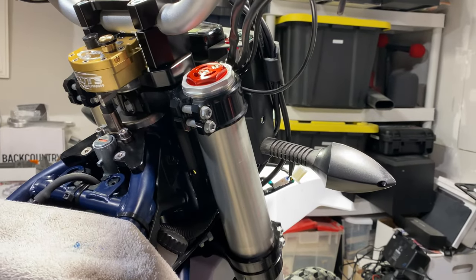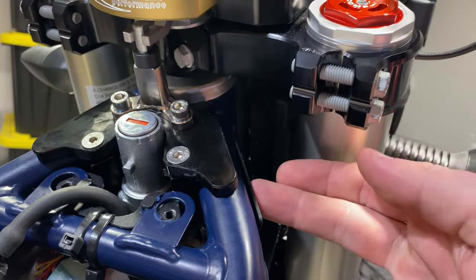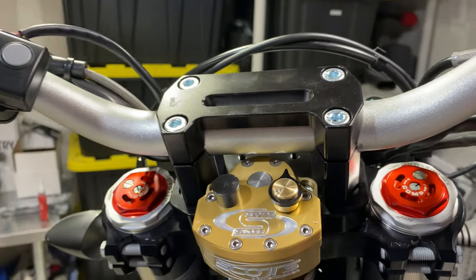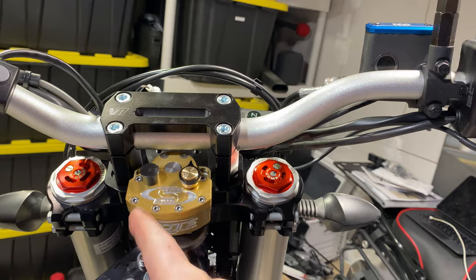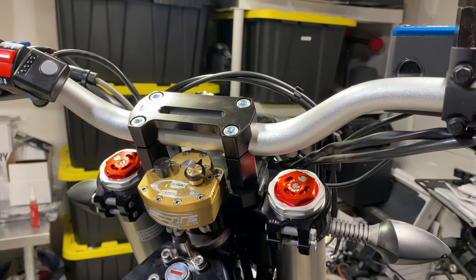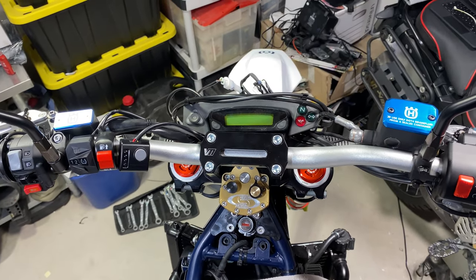For those of you fast forwarding to the end: you have this piece here with your arms underneath, bolting into each side of the upper frame. You have this assembly here, and as you go up you've got the lower mount to the upper and then finally up top. The bar is 32 inches across, so you can do 16 inches to this point to get it dead center. Torque these down — I applied a very, very thin layer of Loctite 243 to everything except for the lower bolts here, because those are locking nuts. There's your top-down view right there.